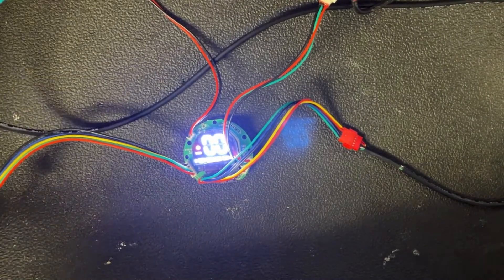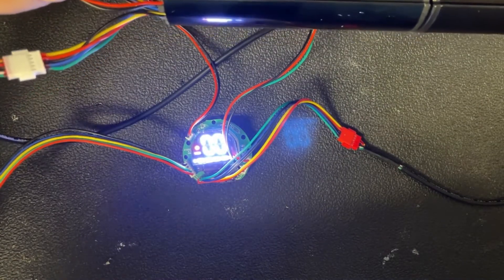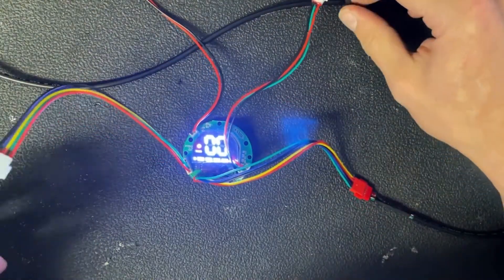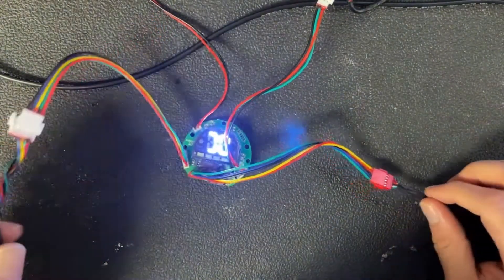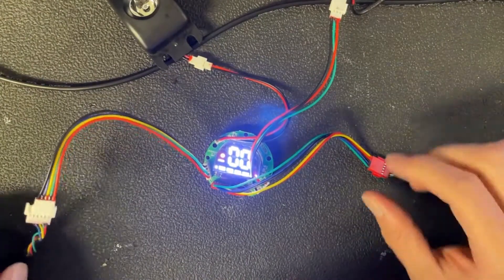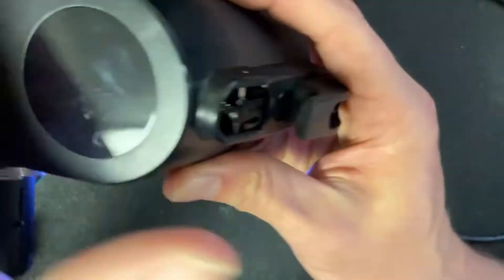The hall cable runs all the way down to the controller. I have this set up with the motor and everything intact, including the battery, just to have it powered on. It's a good way to test your LCD outside of the top housing — you can have all the functionality you normally would if it was assembled within the scooter, including the headlight.